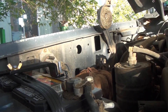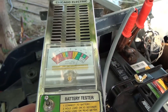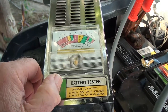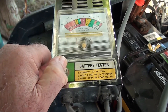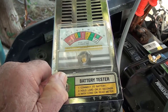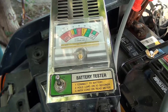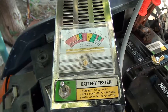I'm going to check my battery first. This is the battery tester I use — got this from Harbor Freight. I want it to stay in the green right here, and you can see the needle is in the green. You hold the load switch down for 10 seconds. Okay, it just stayed in the green, and the battery's good. This thing will develop some heat in here, so you'll want to let it cool down before you put it away.